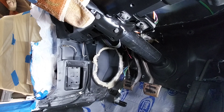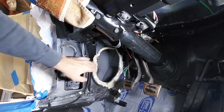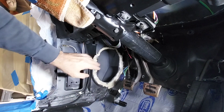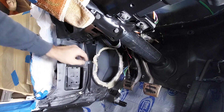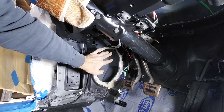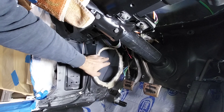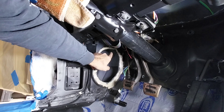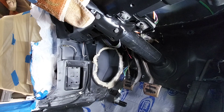All right, so now I'm doing the driver's side. This one is just slightly different. I'm gonna install it mostly on the top because in one of my next videos, you'll see the parking brake assembly that's right here and it goes right in front of this kick panel. There's one screw at the very top that you cannot get to unless that parking brake assembly is off.